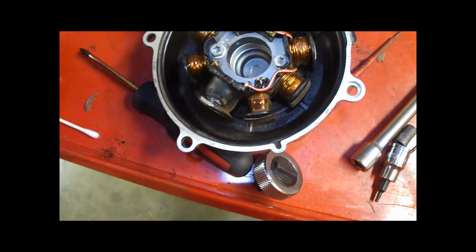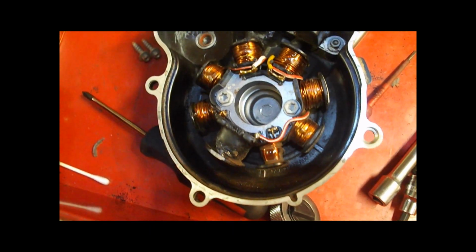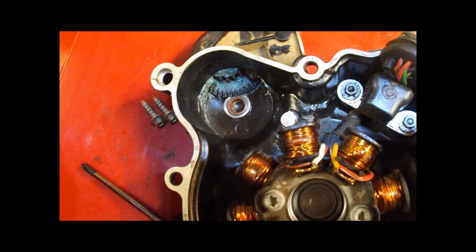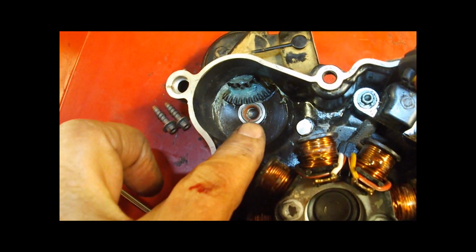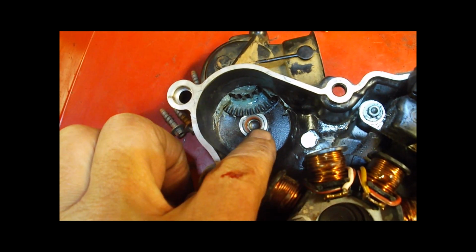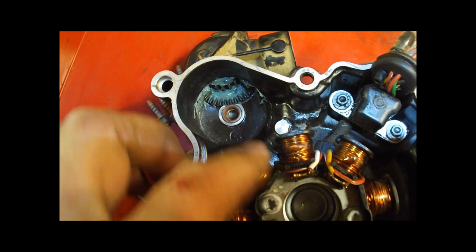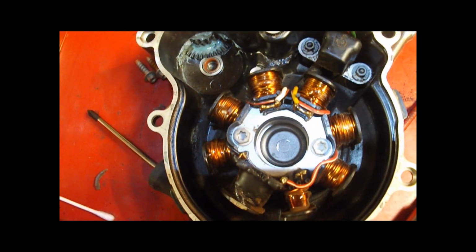So I'm going to do the Slavens Wet Mod also, and well, let me show you. Here's the other collar, and this is where the other end of the Bendix rides. You can see the collar in there. You can replace that little Teflon collar, and it's pretty easy to do. Just some reverse snap ring pliers.